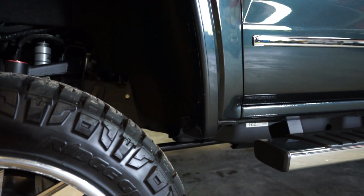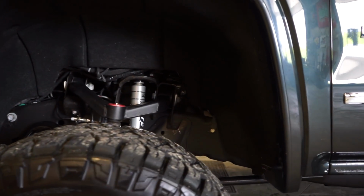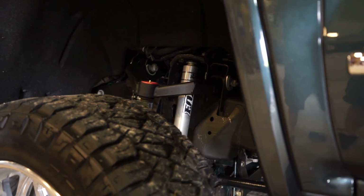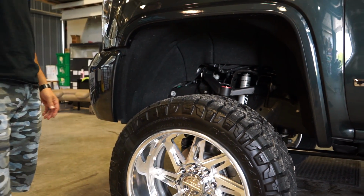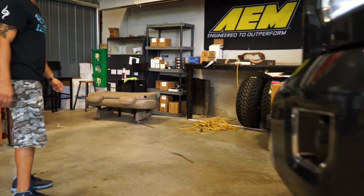But because he's got the 5 inch block in the back and he's got the front cranked up, that lift is actually probably a little bit over the 6.5 inches up front, because the way it's designed is that you'd leave that front down, but then you've got all the rake in the vehicle. And it just doesn't have that clean look that we're all looking for. So front to back, there is a whole bunch going on.